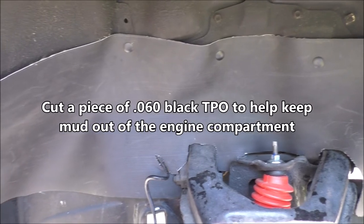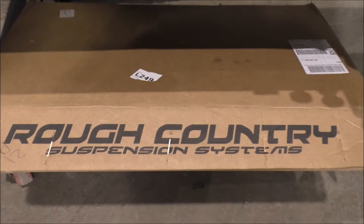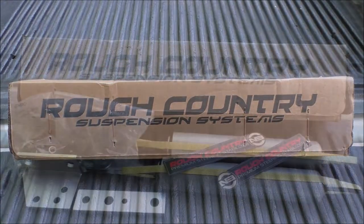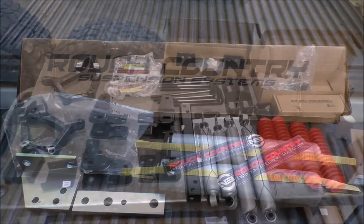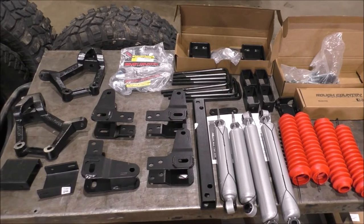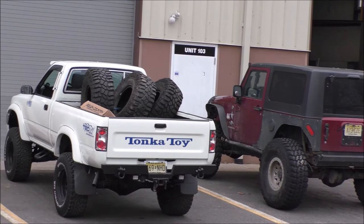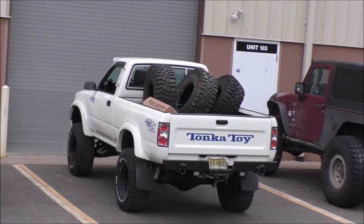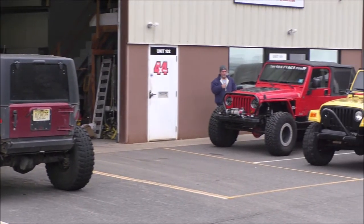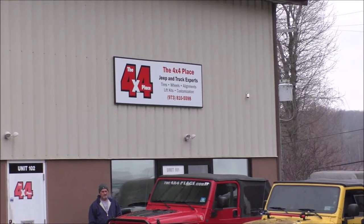Now it is time for the trail rig suspension lift. I went with Rough Country's 4-5 inch lift and also upgraded to Rough Country's dual steering stabilizers. Since the truck already had a 3-inch body lift, this will give our truck 8 inches of total lift. I went to go for 35-inch tires and I lucked out again — I found 35's on Facebook Marketplace, 5 tires for $400, and the Cooper Discoverer STT Pros didn't even have much wear at all.